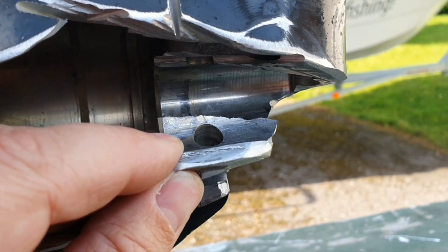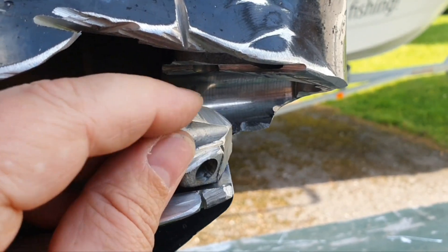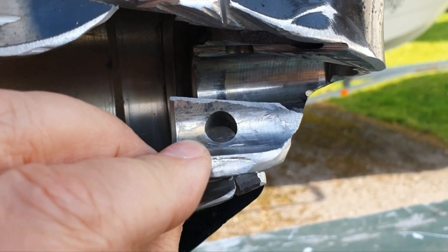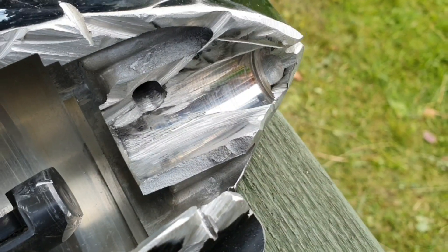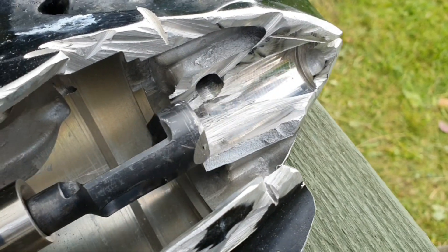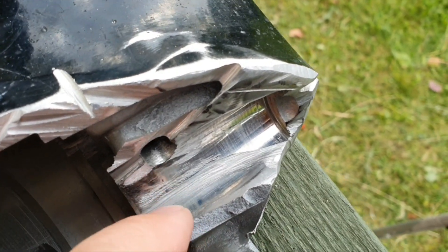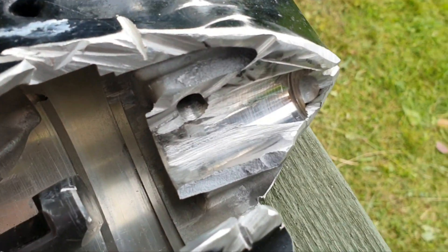Now I will not be able to effectively demonstrate, for example, how the shift shaft goes into this hole. But I will keep this piece and you will see something anyway. I actually don't regret that I damaged this wall, because even without it the cam follower was stuck somewhere here. Now it has free motion because I was able to access this place after damaging the wall - to remove some metal here, here, and there using a Makita. That's the only tool I have available in my garage.